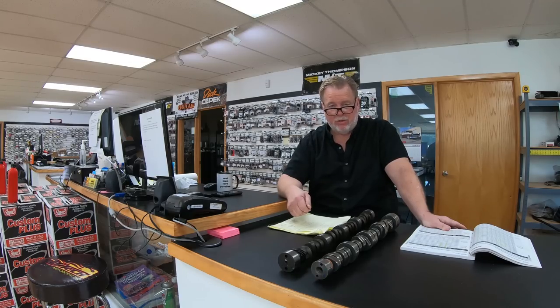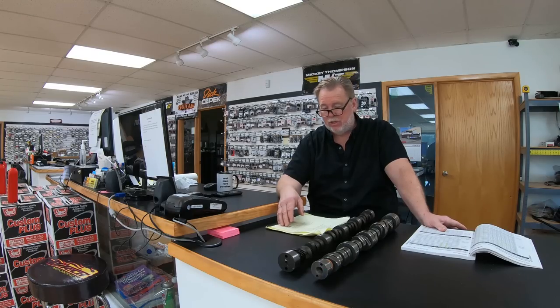Continuing on with lift — 0.600" is the number. I did a lot of work cranking lift up and down, trying different exhaust lift configurations to get better flow, and it didn't make a whole lot of difference. In simplicity's sake, you want to go to the maximum or close to the maximum flow number for both intake and exhaust, and just put the lift there. An LS cam is going to be 0.600" to 0.610" lift. The springs become kind of unstable above that, so we stay there.